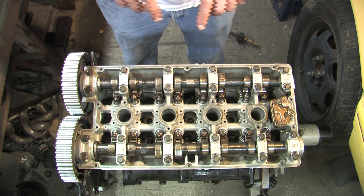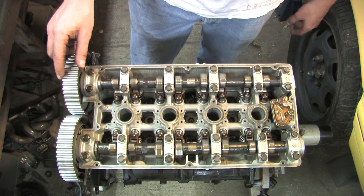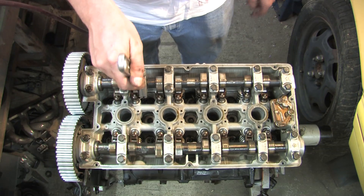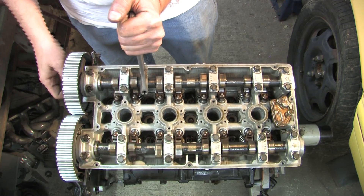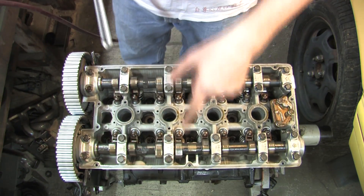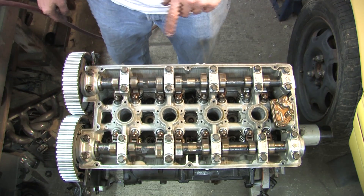Mitsubishi has a specified order for taking the bolts loose. To deal with the cam seal on this side, it helps to remove the cam gears first. I am just going to use an impact wrench and buzz that right off. There is a hex cast into the camshaft that gives you a surface to slap a wrench on to hold the camshaft still. It is important to have both camshafts marked for intake and exhaust. These are HKS cams and they are actually marked I and E, and 264 and 272.